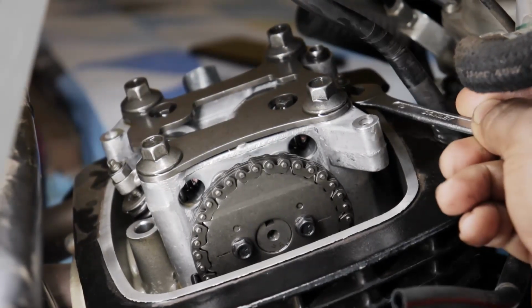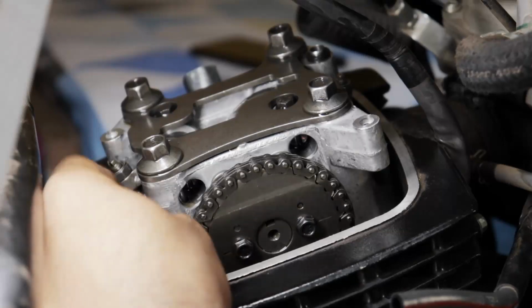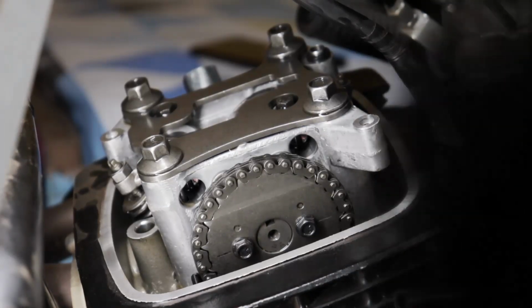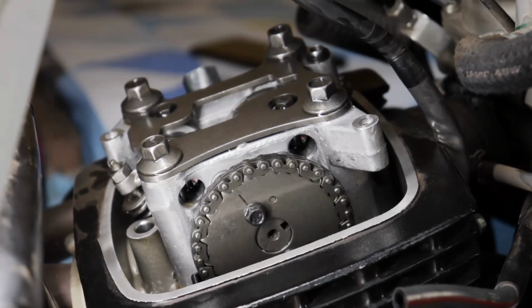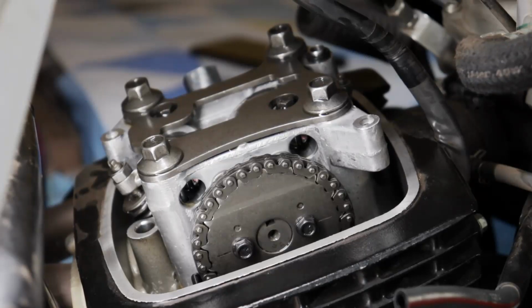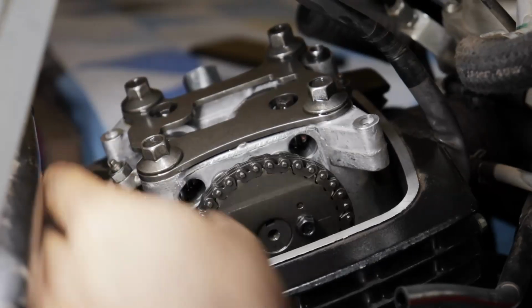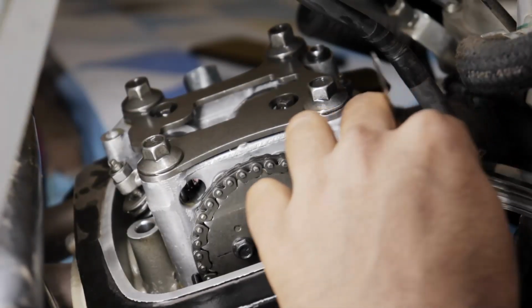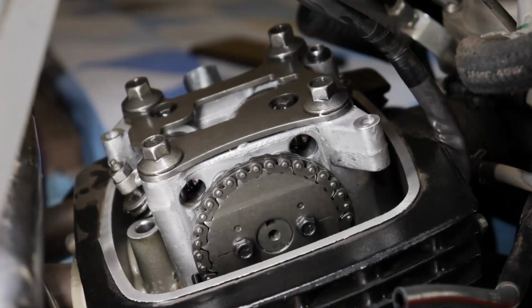TVS, also an Indian bike manufacturer, has designed its 200cc engine based on the same principle. They rebored their old engines. Hero rebored a 150cc, TVS rebored a 180cc. But TVS had the foresight to use an oil cooler on the engine. So by installing the oil cooler, they got the temperature of the engine significantly down. By decreasing the temperature, you could keep narrower tolerances. Narrower tolerances means significantly less movement, lateral or vertical, significantly less backlash in a system. By narrow tolerances, you will be able to perceive that the engine is running smoother.